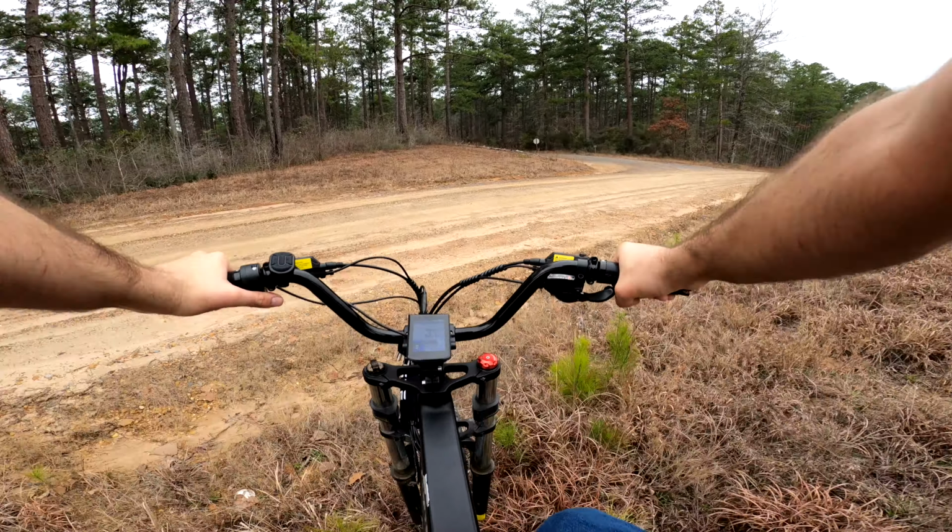If working as they intended from the factory, then the triple rear suspension is a straight-up gimmick. The middle shock doesn't do anything, it almost never moves, and the rear shocks, which are air coilover shocks, that's nice, but they're so stiff out of the box, they don't really do much either, leading this to have less rear suspension than standard swing arm setups with a single shock.